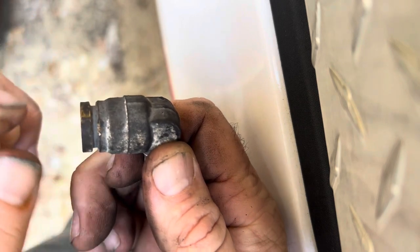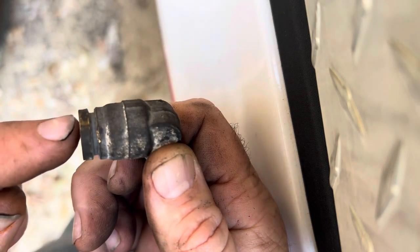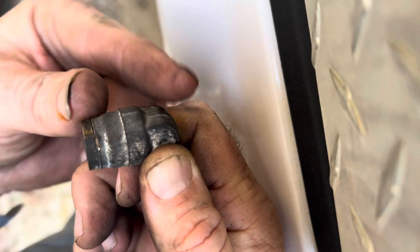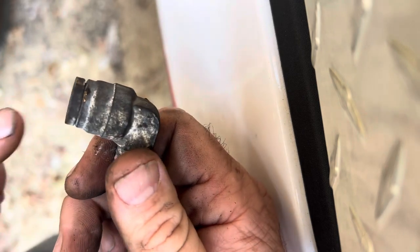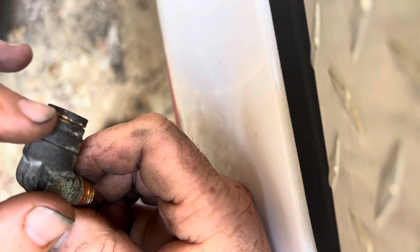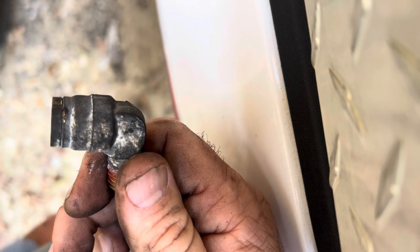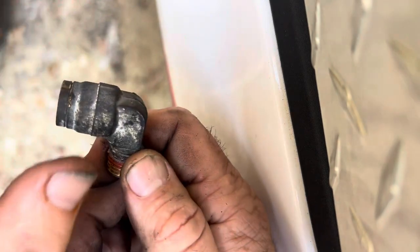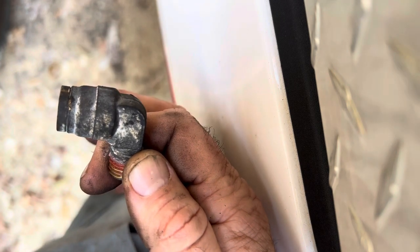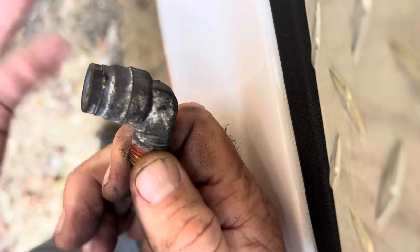To disconnect: shove everything all the way in as hard as you can, hold this collar in, then work the tubing out. These fittings are actually very cheap to just go ahead and replace if you wanted to. There's nothing wrong with this fitting — the teeth are in great shape. We've had it sitting overnight waiting on the bag, and the hose has been pressured up with no air leaking out. You should probably keep a couple of spare airline fittings, some unions, some elbows, maybe some straights for your front brakes, and a small section of tubing — in case you break a line, you have a union, snap it back in there, and go on about your business.